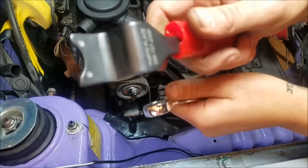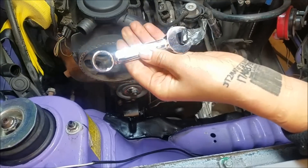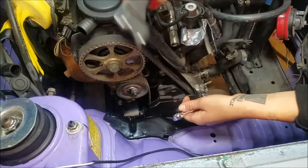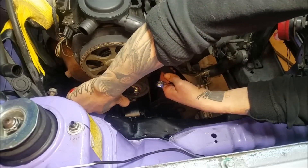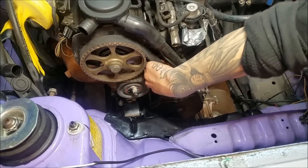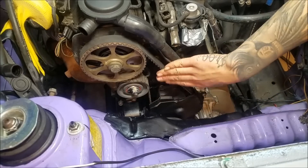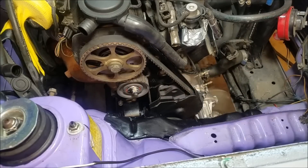Now I'm going to tension my belt. I've got my special tool from the parts place for moving this tensioner, and my shorty 17 millimeter — I don't want to put too much torque on the nut since I'll be torquing it properly after. Put the two little notches of the tool into the two notches of the tensioner and rotate it clockwise. You want to tighten it until you can rotate the belt about 90 degrees, but no more. If the timing belt is too tight it'll whine; if it's too loose you'll hear a flapping sound under the timing cover.